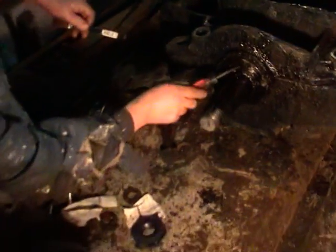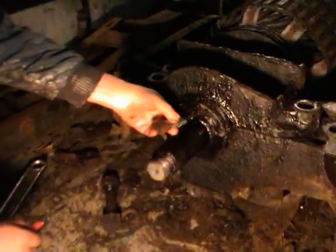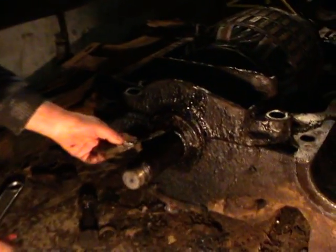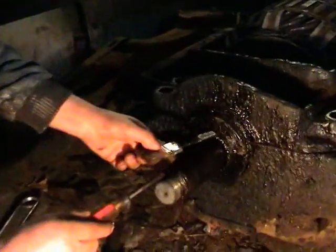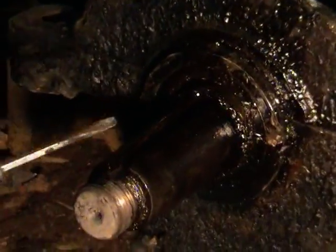We can find something to stick in there that shows that. All right. Here's the shaft. There's the screwdriver. That goes right in there, and there's plenty of room to spare. Now, that should be 15 thousandths of an inch, maybe less than that. And so what's happened is this wore over the years. This is a bronze shell.